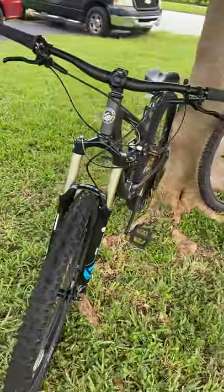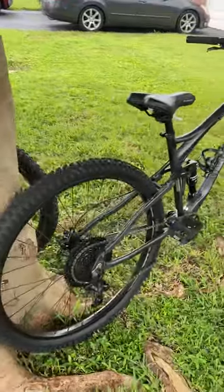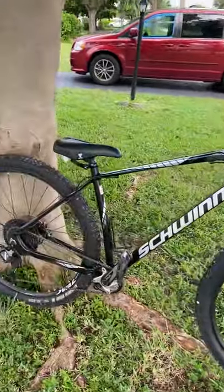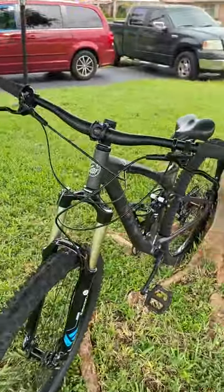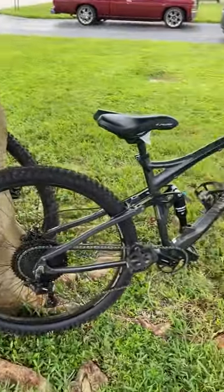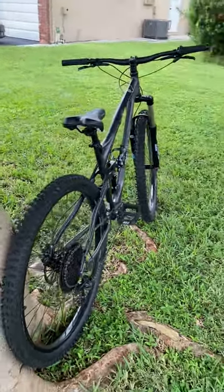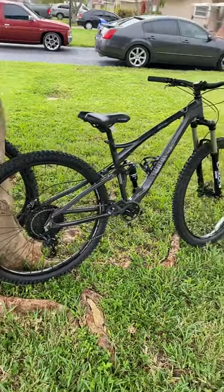The discs are 160mm front and back from Avid. The bike is solid and really good — it's a great addition to the family. She's ready to rock and she does rock, but I'm trying to save some weight. The Schwinn TAF came out really well weight-wise — it came in at 37 pounds and is now down to 30, and it's a blast to ride. I didn't weigh the Mongoose before all the upgrades, but I think it came in around 38–39 pounds, so even with all the upgrades it didn't shave much. That's why I'm changing the wheels and tires — going with Vittoria Mezcal front and back, 2.25, with Vuelta lightweight wheels. Hopefully that shaves at least two pounds, bringing it down to 35 and making it more enjoyable.